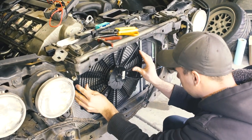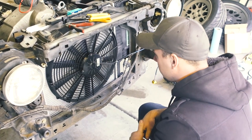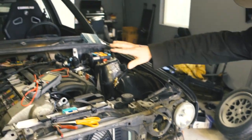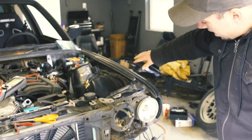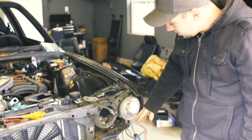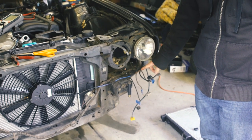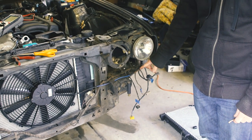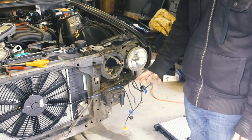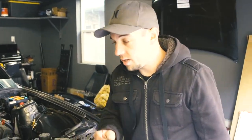Let's zip-tie this in place for the meantime, right there. Let's go through the system really quick again: you've got power going to the relay, the power is jumped by the little fan switch, and the power is fed to the fan. We actually messed up and had to use the high speed relay — it's pretty much the same procedure, except instead of using the normal speed you use the high speed. So we have power pretty much ready to go, it just needs to be jumped.